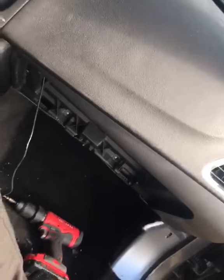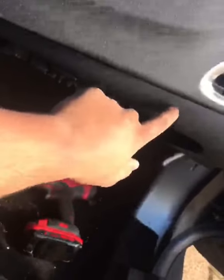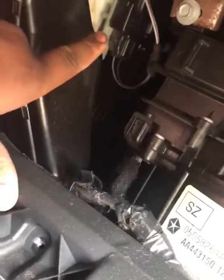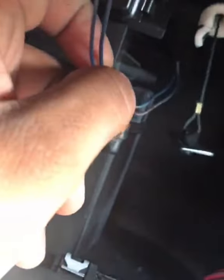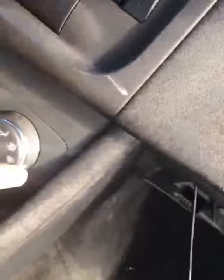This one has three actuators. However, the one we're dealing with today is this side. From under the bottom, you can see on the passenger side there's one right here. This one, if I'm not mistaken, is for the temperature. There's one over here that this cable is running to — I'm not sure if it's just for the defrost or all modes. But specifically when you turn on the defrost or go through these modes, there's a clicking, and it's coming from that one on the side.